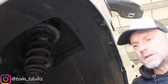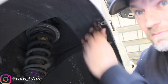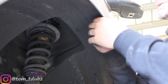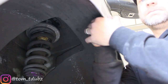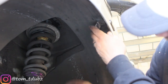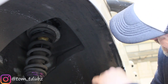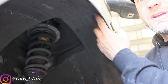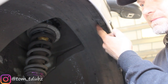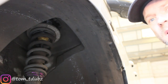When you get these screws out keep them because they're quite handy. Screw out. What you can see here — we're going to bend this bit of metal up into the frame, up into the wheel arch. I'm going to cut this little bit off here, and then we're going to apply some heat and push it up a little bit, remould it just to get rid of this. Let's get that heated up.